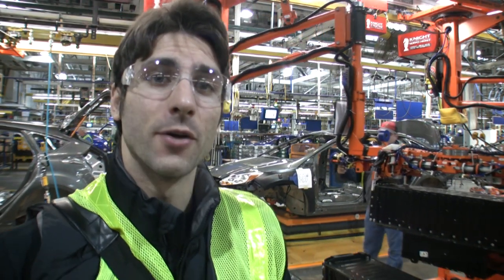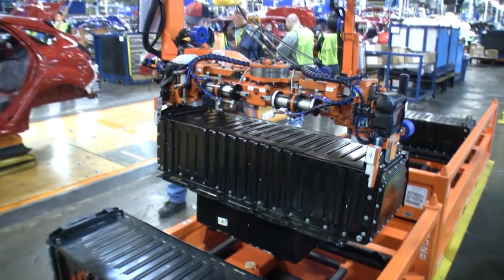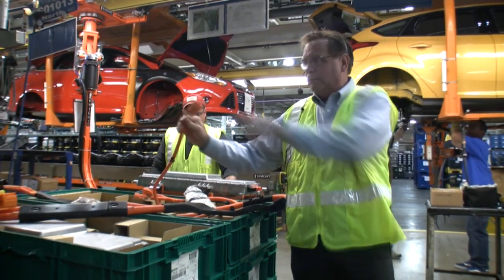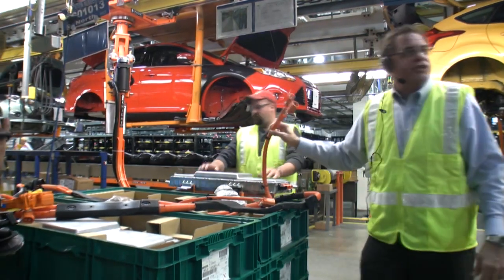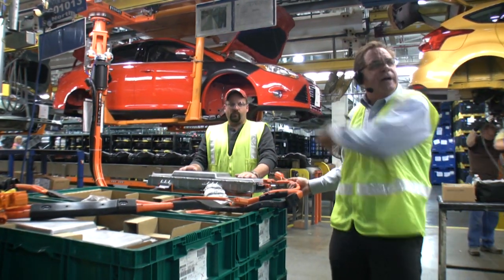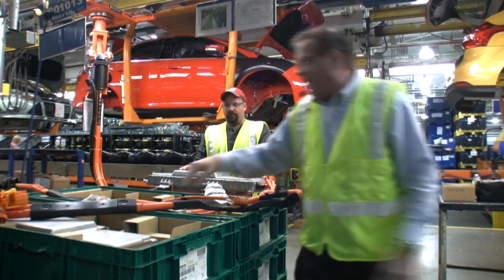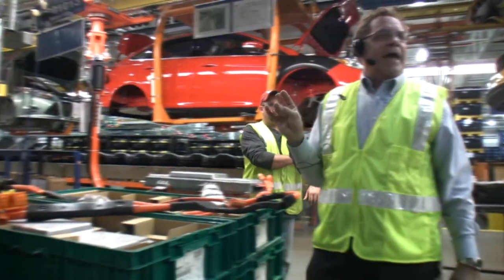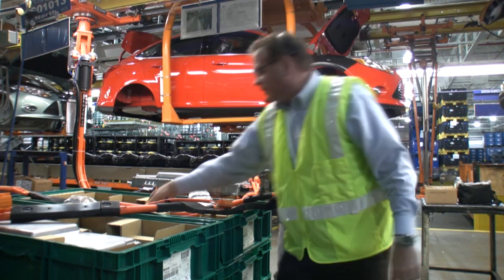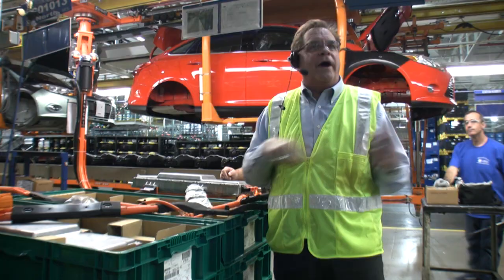Behind me you'll see the lithium-ion battery for the Ford Focus electric. I plug my vehicle into my charge port, which connects up to this port. From that point, the energy goes to these connections that go into my charger. In here, the energy comes in and comes back out. It travels back down to these connections — one here and one here for the upper and lower battery. From that point it's transferred out to this connection, which goes to the motor. So this would be kind of like the powertrain, but electrical-wise.